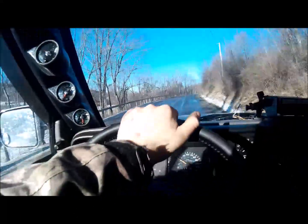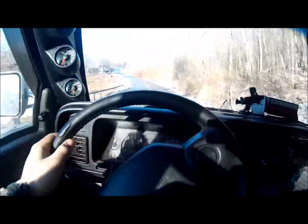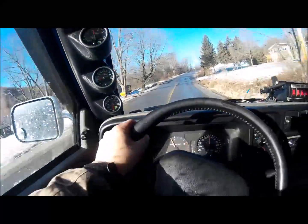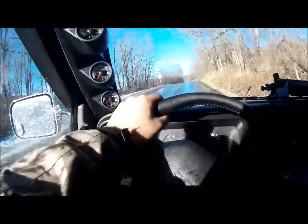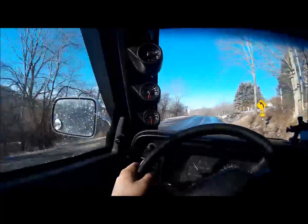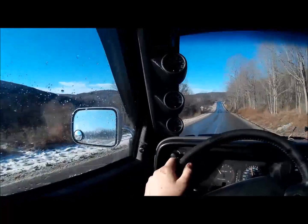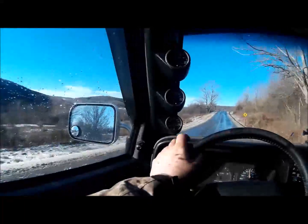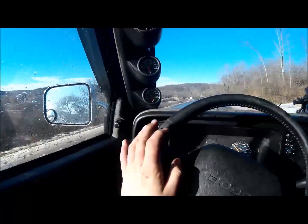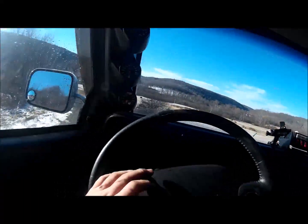Give it a moment — we'll get to a part of the road that's not a sheet of ice, like every road is around here right now. She definitely does come into boost a bit quicker. The truck only builds about 20 pounds of boost — I'm still relatively stock and haven't played with the star wheel that much. I have an adjustable boost elbow and I think I can probably get that up into the 25 PSI range without grinding my fuel plate or doing a couple other mods, but that's all in the future. Most of it I'll probably put on video, so I guess we'll call it that for now — talk to you folks later.